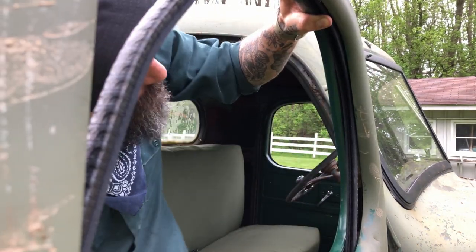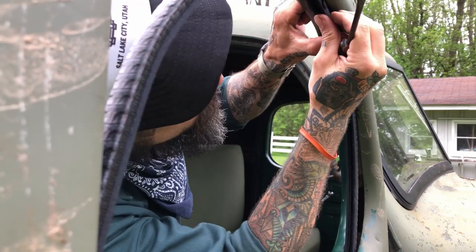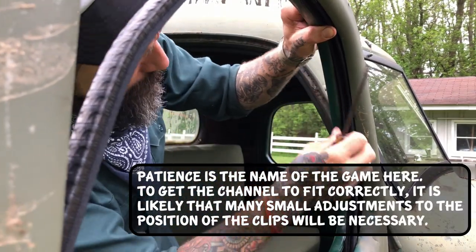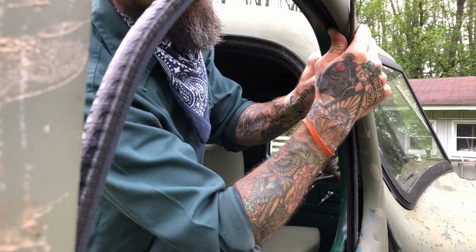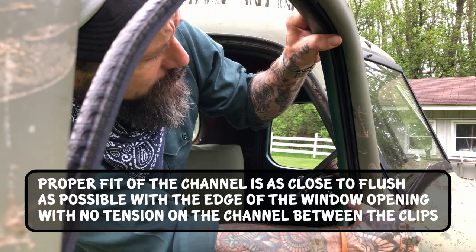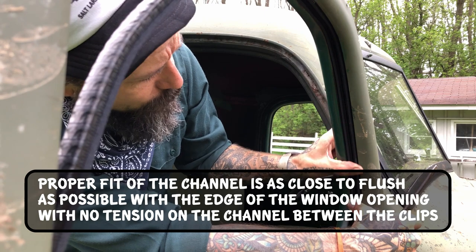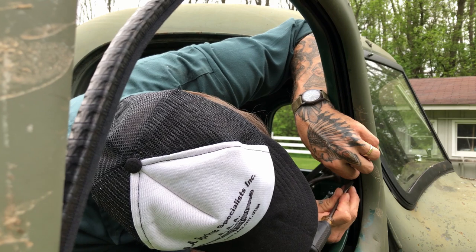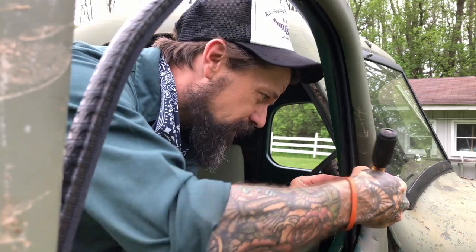It takes a little repositioning to get them right, sometimes a little force. I like to use a screwdriver and push them in. It's very important to push this channel up into the slot as far as you can — you don't want to lose the curvature of the door though. Run your finger along and you can feel the door and feel this channel right flush with it. Make just a little mark with a screwdriver so you know right where the center of the clip will be.